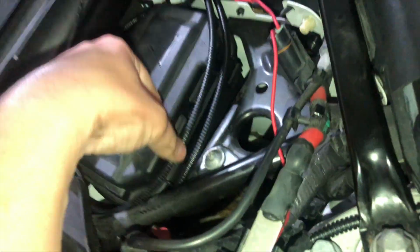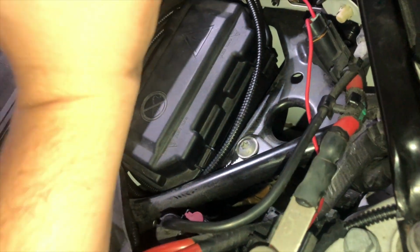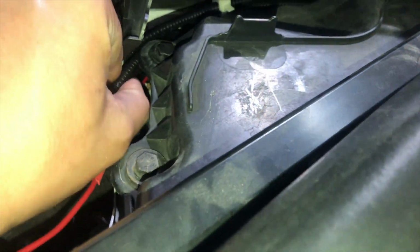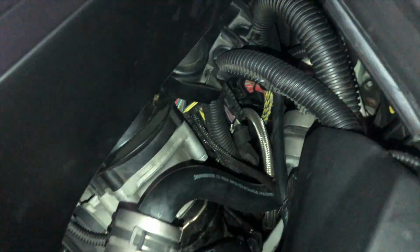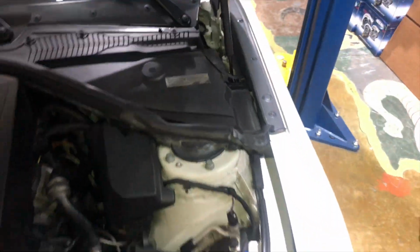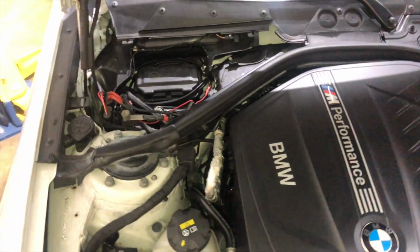With a neat wiring harness, I'm sure you can have certainty 100% that your stuff is going to be running good. My harness going all the way here, it's fully strapped down. You can see here as well my wirings. This is also from the Haltech. This is going to the injectors, going to the flex fuel. You can see it here, it's running as near as the OEM wiring as possible. The wires have holders, so it's fully designed for that. This is my fuel line as well, it's braided, and just keep everything neat. You can see everything here, it's organized. You're not going to have any issues with this stuff if you do everything organized.